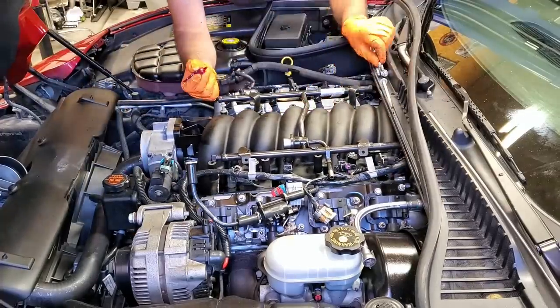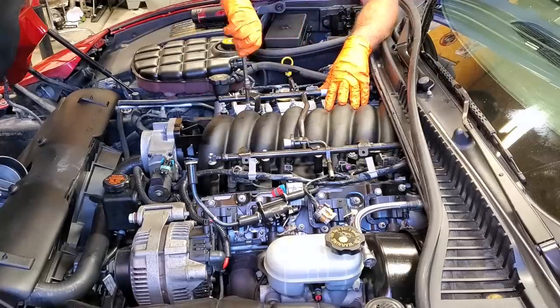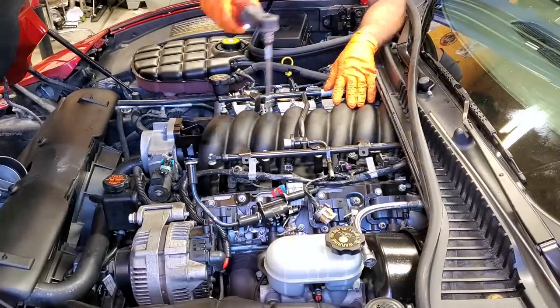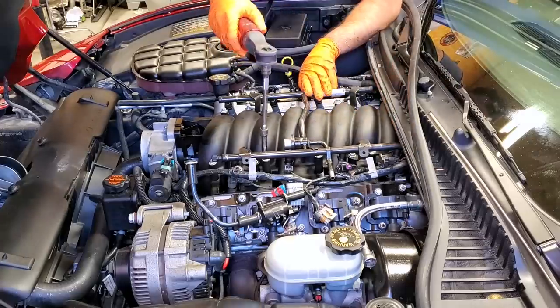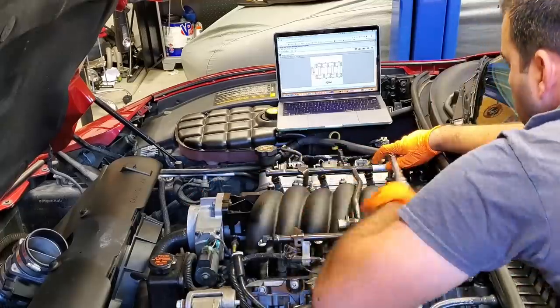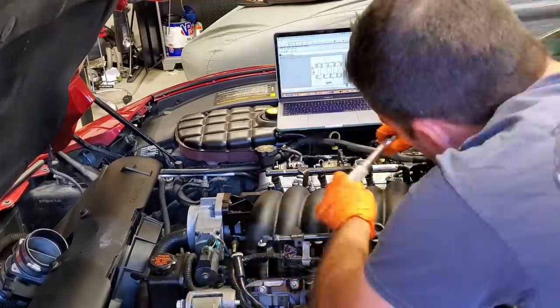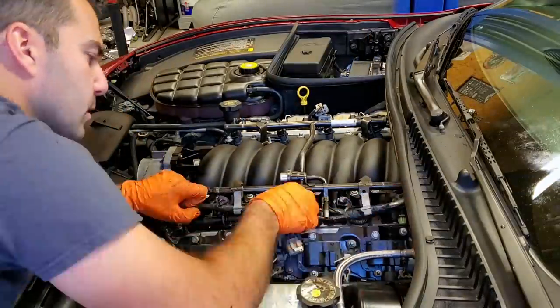factor will be gearing. The advantage of having a large V8 is that the car can chug along nicely at a very, very low RPM. We're going to see how far we can go with tuning first, but eventually I may experiment with rear end gearing, or I'll get a different sixth gear installed in the transmission, and in that case I'll be able to keep the performance factory 3.42 rear gears and have the best of both worlds.